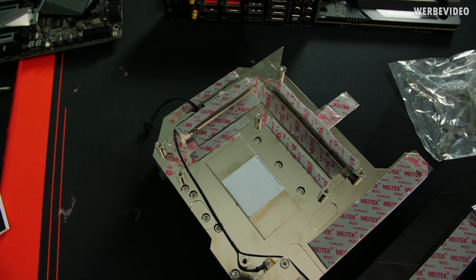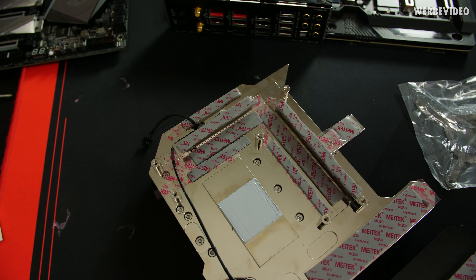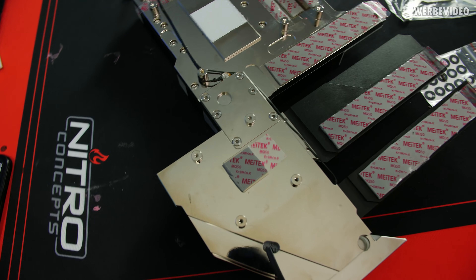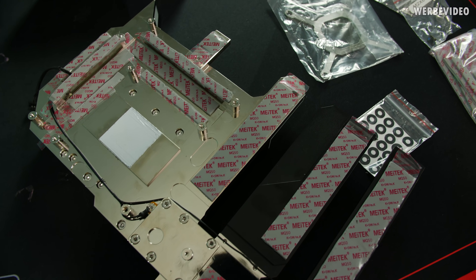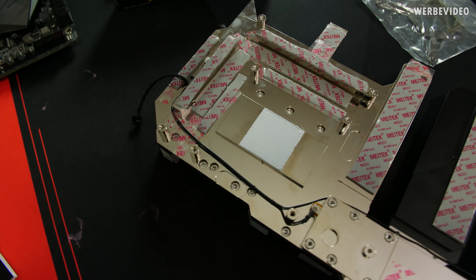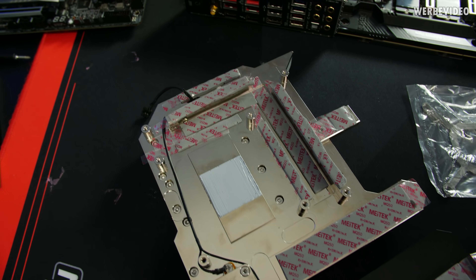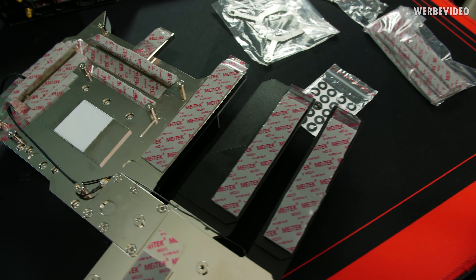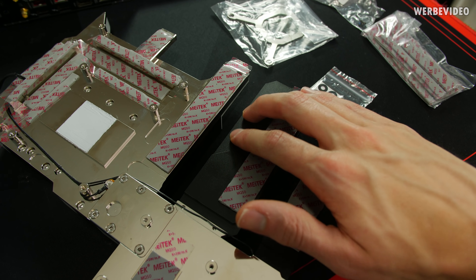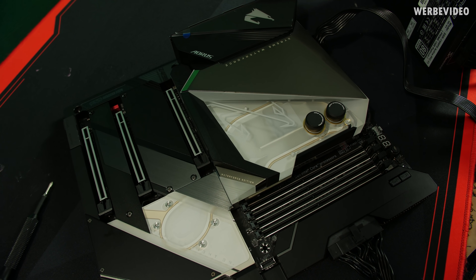First, a quick look at the back side of the water block. Everything is pre-installed, which I really appreciate. There are a lot of thermal pads to cover all inductors, power stages, and also the M.2 slots and the chipset — everything covered with foil on the thermal pads. Just peel off the foil and install the block. Thermal paste is already pre-applied for the CPU. The block is made fully out of copper and nickel-plated, meaning you could also use liquid metal. The only part made of aluminium is the section covering the M.2 slot, but since no water flows directly through that part, it's perfectly fine. Alright — installed, let's turn it on and see how it looks.